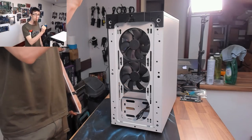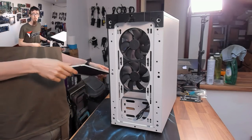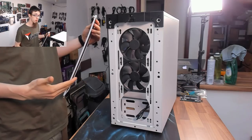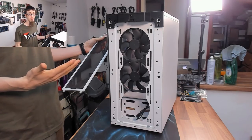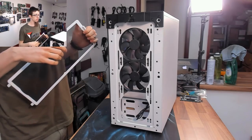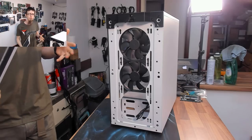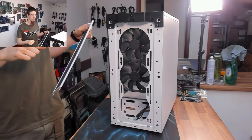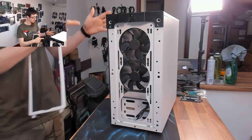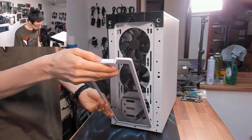And that's the other reason why I bought this case for the build that I'm doing here over the 220T. I really like the Corsair 220T. However, I'm putting a big graphics card into this build. We're putting in a 2080 Super, and that's going to be a long graphics card, big triple fan cooler. And the Corsair 220T starts getting a little bit sketchy when you want to put in an all-in-one water cooler and a very long graphics card. It can be done, but you start having to min-max and start measuring everything up. And for a customer build, I don't really want to start messing around with that. I want to buy a case like this one that's just slightly bigger on the forward dimensions and will just fit everything. So let's stick this guy back on.